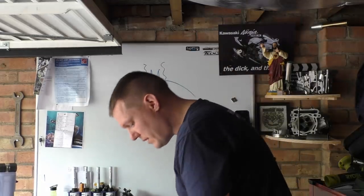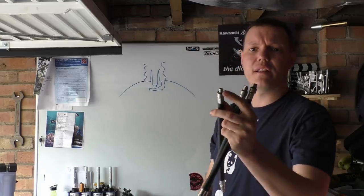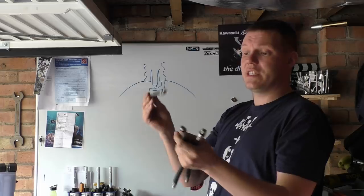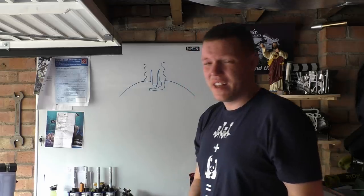I've got my OTC tester — you can see it's an OTC motorcycle compression kit. It comes with three different sizes of adapters for all your plugs on these long tubes, and then it comes with the actual compression tester itself, which is this. The way this works is these have Schrader valves in the ends. So this is sealed off — if I give this a push, nothing happens.